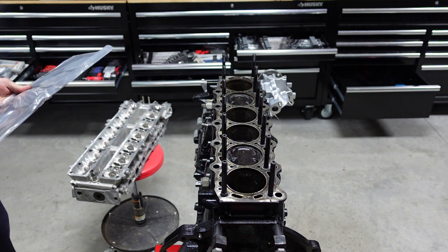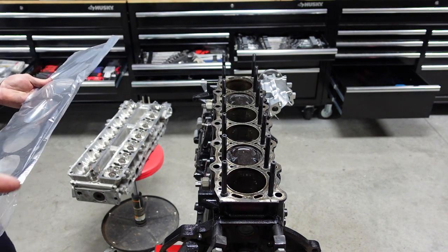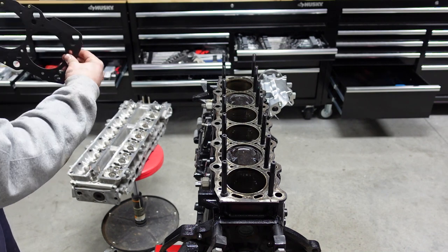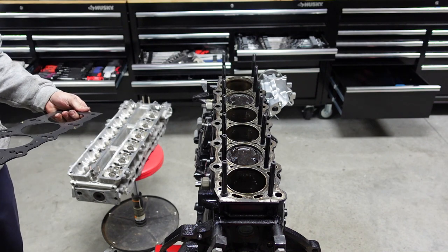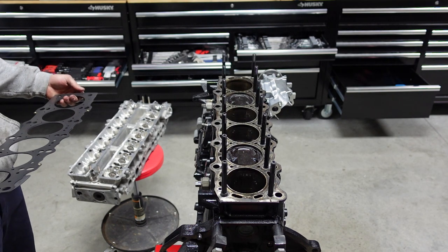You put this on because, one, it's a better gasket, it's a little bit thicker. When you're running a stock NA engine, you're already running high compression. On top of that then, you already milled the block or milled the head. We milled the head 5 thou, was it 5 or 4 thou? 5 thou. It was 5 thousandths that had to be milled off the head to get it truly flat, which isn't ideal, but it ended up working.